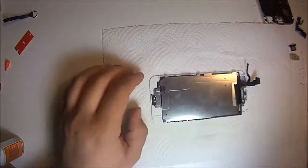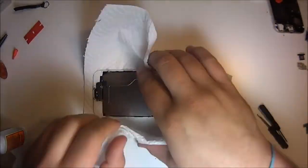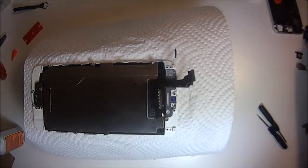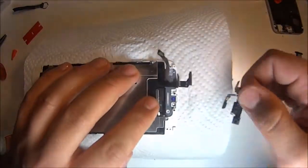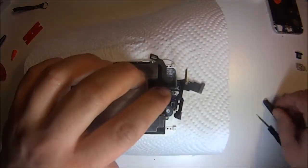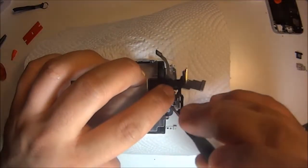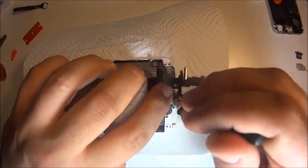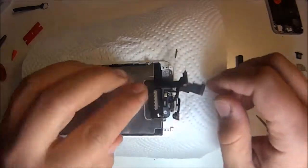The glass that we have here too, sometimes you buy the iPhone glass from China, and then what happens is that your phone works and then your sensor doesn't. You have that sensor that whenever you're on a phone call, you always mute people, because the sensor is supposed to power off when it's on your face. So obviously if you have cheap glass, it's not really going to power off. It's just going to be lit up the whole time that you're talking on the phone.